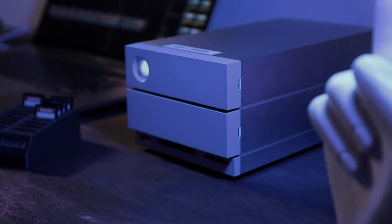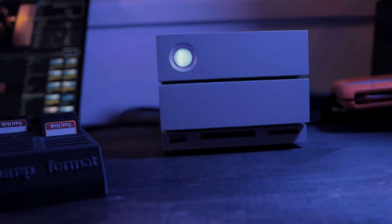Now step three is the ultimate step — get a hard drive that can back up footage. My edit drive is 16 terabytes set in a RAID configuration, which lets me edit off eight terabytes while the other eight terabytes is an exact mirror copy. You lose half the space, but having eight terabytes with automatic backup is great peace of mind. I recommend getting a drive like this LaCie drive that can do RAID. Alternatively, you can get two portable hard drives and set one to Time Machine — it can back up all footage every day onto the other drive, so if one magically falls off your desk, you've got a backup.